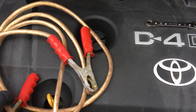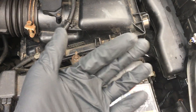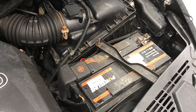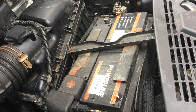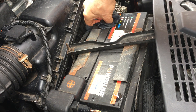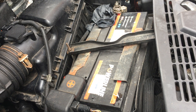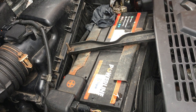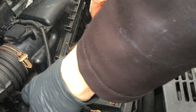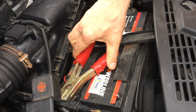The tools that you'll need are a jumper cable and something to undo the battery terminals on your car, and some rubber gloves. What we're going to do is go ahead and get the terminal disconnected on the negative side of the battery. I'm going to put a rubber glove over the negative terminal so that the negative can't earth, and then we're going to connect the negative lead to the positive like so.